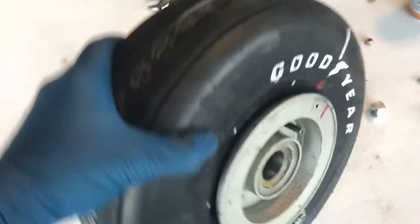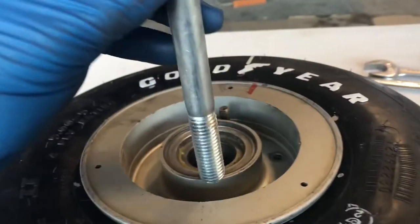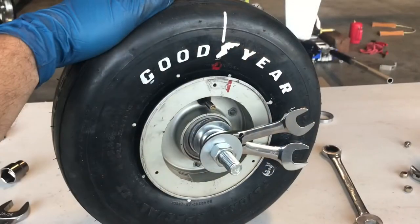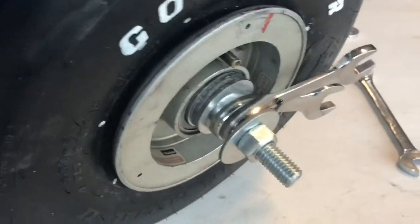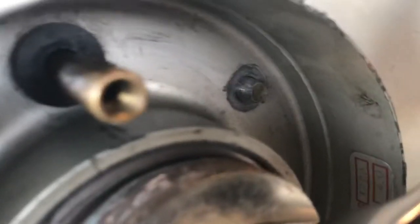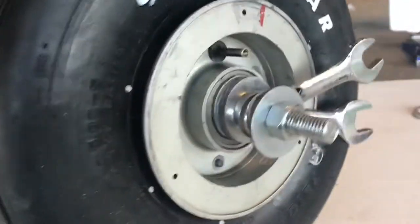You have a hard time squishing the sidewall in order to get the wheel half bolts all the way through. So what I like to do is take an extra long bolt we got from the hardware store, put that through, and clamp the wheel together — actually squish it with this bolt to make those bolts easier to get through. I put the bolt through the wheel, and since I didn't have enough washers, I put some wrenches underneath it. Tighten it down by hand and that gives us just enough room where our wheel half bolts reach through, we can put our nuts on and torque down the wheel half, then remove this and be done.